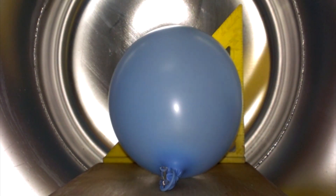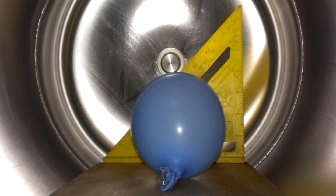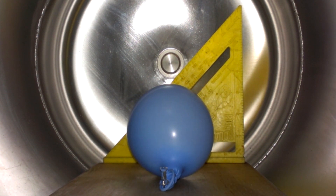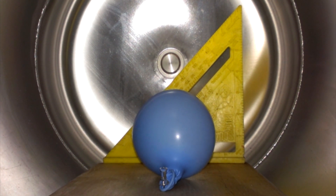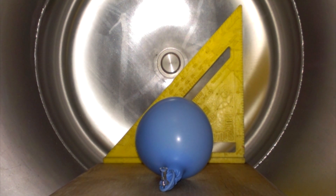As soon as the pressurized air started rushing into the vessel, the balloon started to shrink and fluttered very fast. The fluttering was caused by the entering air rushing by the balloon. As time went on, we reached 7.5 bars of pressure. The balloon was compressed to a fraction of its original volume, but not less than one-seventh as one might expect, because the air in the balloon is already pre-compressed under normal atmospheric pressure — otherwise balloons wouldn't burst with a bang. When we released the pressure, we saw the same condensation phenomenon as with the vacuum tests, only this time the pressure drop was even sharper and longer, with much more moisture in the vessel. The iPhone was dripping wet when we took it out, but it was still working, so we started to become really impressed.